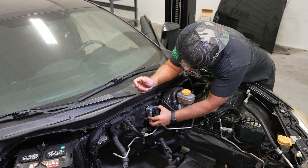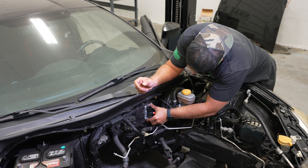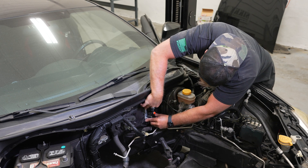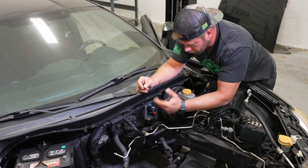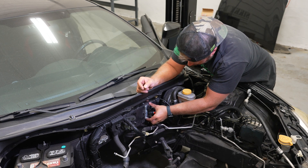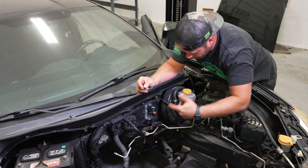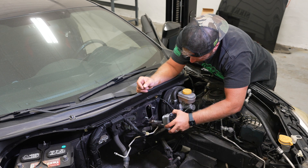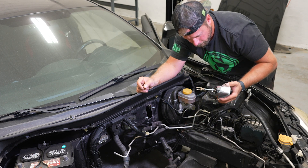All right, so now we got that all cleaned up — we're going to check fit real quick here. Looks perfect. So it's designed to be right underneath this weld on the firewall. It just sits right over the factory studs. You should have a little bit of wiggle room the way the template's designed — it shouldn't be like forcing it one way on the stud or the other, it should be able to kind of float around. The studs are in the middle of these machined holes but there's a little bit of wiggle room. So it should be rocking like that. It's not the end of the world if it's tight, but you just don't want to force it one way or the other. Looks good, so we're going to pull this back off, clean the firewall up, get a little bit of paint on some of these exposed metal areas, and move on to mounting this thing for good.